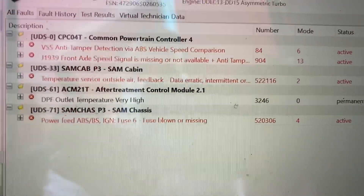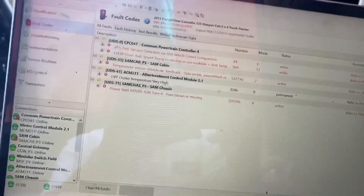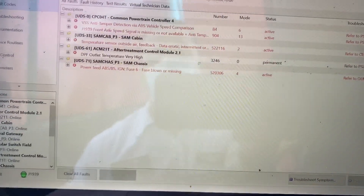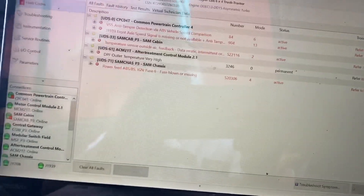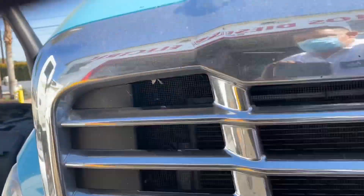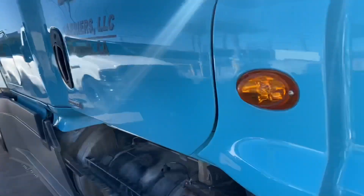When we do a regen, that temperature got really high at about 1,200 degrees, which is way more than normal. So we replaced the sensor. This is all one-box related, so before you start taking out your one box and before you start sending the filters to get cleaned, let me go over this while we're shooting so you guys can get a pretty good idea of what's going on.